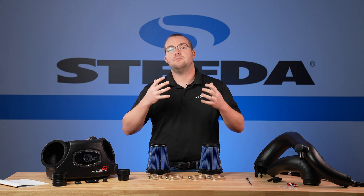Start by inserting the isolator from the factory air box and insert it into the AFE air box as shown. Then you can install one of the filters on the left side of the air box, leaving the right side open for now. Starting on the larger of the intake tubes, grab the oblong grommet and insert it into the according hole — the logo will face outwards. Then the plastic fitting can be placed inside. Make sure the fitting and the grommet properly seal and are flush with each other. It might take a little finessing to get it perfectly in place.